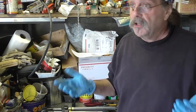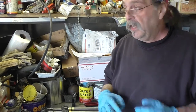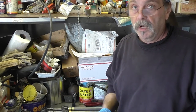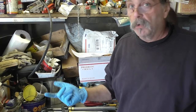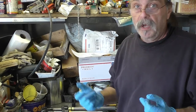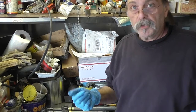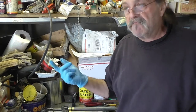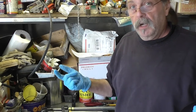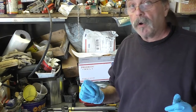You're going to need 2 trim cylinders, 2 working. If you have one that's bad, it's going to screw up the whole thing. So you really need to do this. They both have to work. So rather than buying new ones at approximately $300 a piece, $600 for a pair of trim cylinders, I'm going to rebuild these again. I've bought a couple over the years and I've lucked out. I've had a couple of good ones, and I've had a couple that have only lasted half a season or so. So it's really pot luck. But they are rebuildable, and the parts, most of them, are still available.